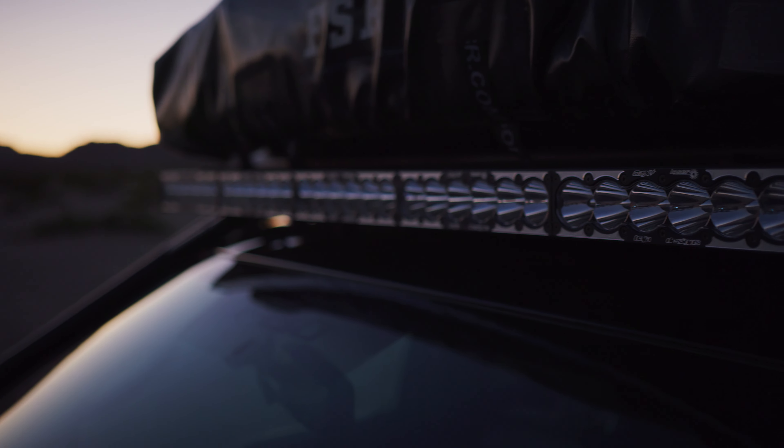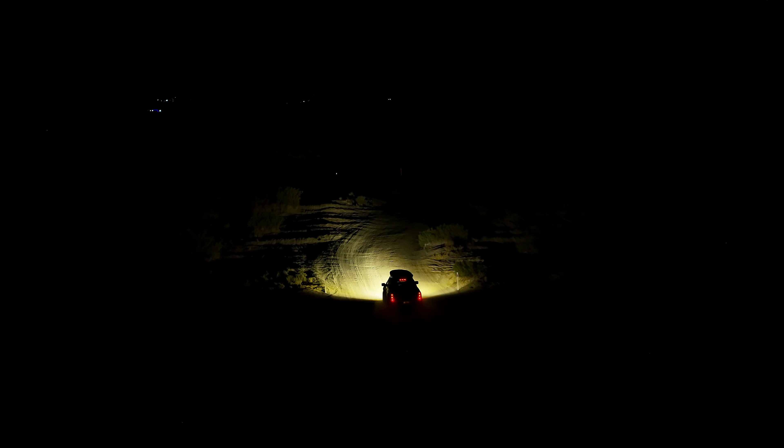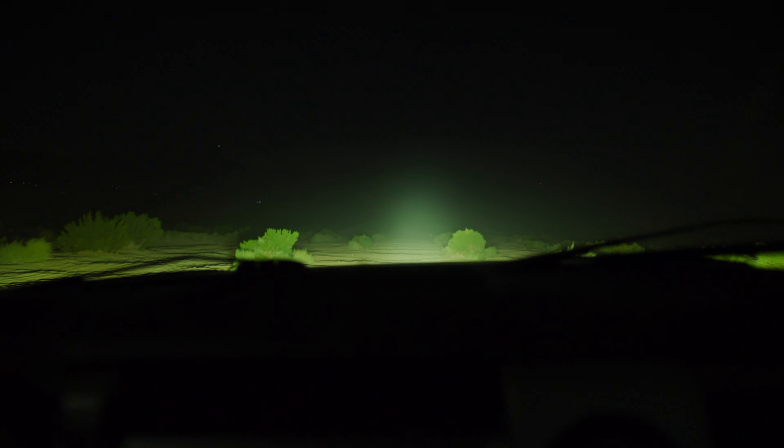In quick summary, these lights can be placed higher up on the vehicle, such as the roof and A-pillar. They should be brighter than Zone 3 using a spot lens for the tightest beam. Consider when you use the lights in the spot zone as necessary, and avoid unnecessary fatigue while driving.